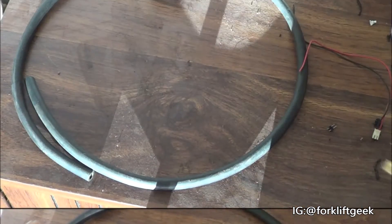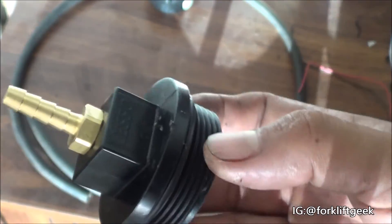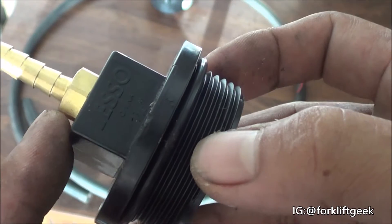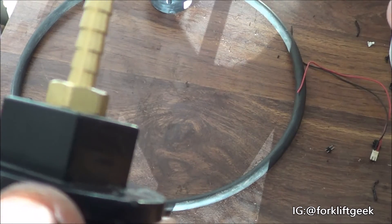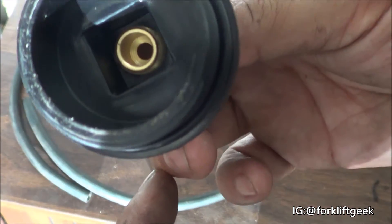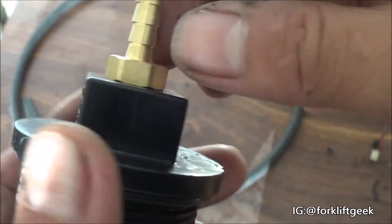The first thing I did was drill a hole through the plug. It's somewhere between one-half and nine-sixteenths — basically that hole size, because there's a taper on that thread. You don't want it too small or too big so that the barb won't be able to fit or thread down and tighten. That's what it looks like on the inside — it's threaded in through the plastic. I might have to put some silicone on it just so it seals up.